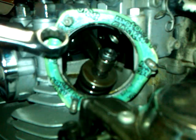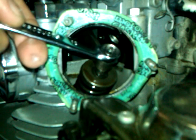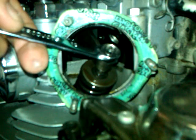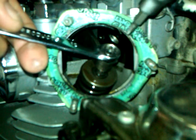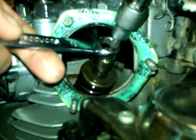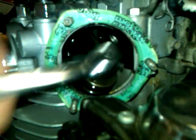One rule of thumb — when you do this, you can mess it up really fast and you'll be all over the place. This takes a little finesse. You always want to put your wrench on the lock nut first. When you loosen it, you'll notice your tappet is going to move, so you kind of have to use two hands at once. Hold the tappet tight while you turn and loosen the lock nut, so your tappet stays in place.